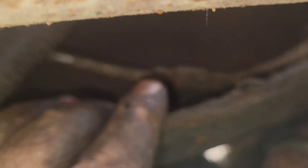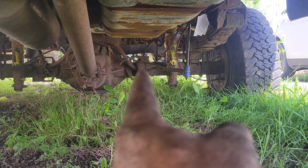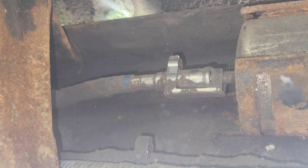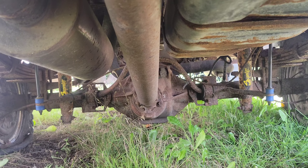All four front lines have now been completely replaced — all brand new coated steel. My next mission is to get this one off, because these guys have sectioned it all the way down. The line's not bad all the way down, it's a little crusty at the flex line. The rear flex line seems in good shape. That top line up there seems a little crusty. I've gone down this entire truck and grabbed the lines — they all seem in pretty good shape, so I might do it after the safety because I'm pretty sure it will pass.